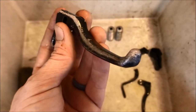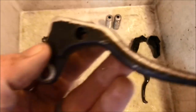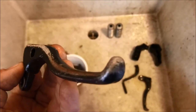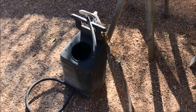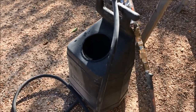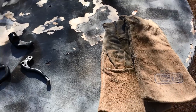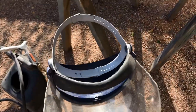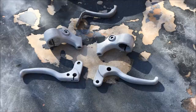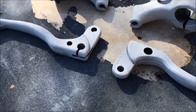Unfortunately the powder-coated parts were another story. I had never tried using molasses to strip powder-coated parts, and as it turns out it doesn't really work. These soaked for two months and the paint looks exactly the same as the day they went in. That means I'm going to have to find another method, and in this case I'm going to be using a portable sandblaster. Sandblasting can be pretty abrasive but these parts are very thick, and I'm not worried about losing any logos, so I think we're going to be okay. I have heavy leather gloves and a face shield, though I don't really have any way of filming the sandblasting without damaging the camera. Here are the parts after sandblasting — it pretty much worked perfectly, with the exception of the finish being fairly rough.